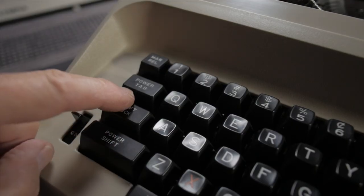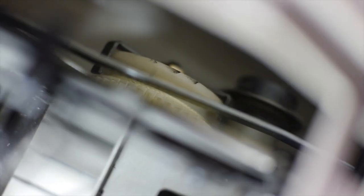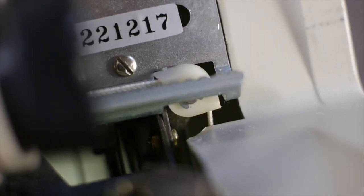There's that little nuisance drive belt. You can see the brass pulley on the motor shaft - it's a toothed V-belt - and it drives the spindle pulley. On the right side of the spindle there's a plastic gear set with a drawstring wrapped around it, and this drawstring serves as the carriage return system that pulls the carriage back.